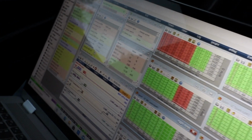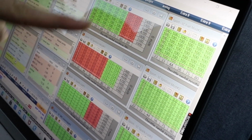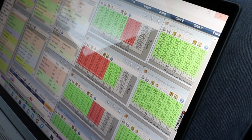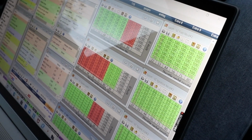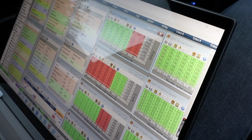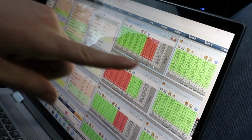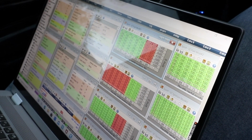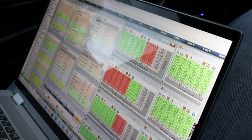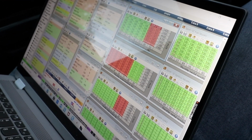Gotcha. So that's why these graphs right here, everything before 80 has not changed. It's all zeros or 100. But everything after 80 is the only part I'm going to be messing with. Oh, because 80% is when it starts. And I had to change all these RPMs to RPMs I would use. So I started at 3,000, went up to 54. So the launch is gonna be somewhere in between that. Same thing with these graphs down here.